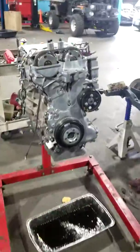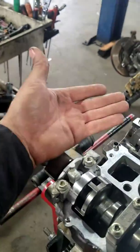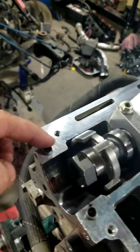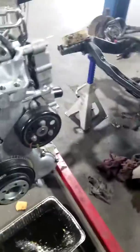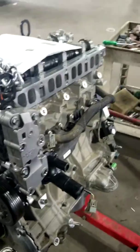Once you've got all that stuff locked in, plug in the back, cams in the back. One more thing to mention: the cam cap in the back — when you take it off to get that tool in, you've got to pull these little dowels out. If you're lucky, they come out on your cam cap. I was not lucky — a little vice grip, a screw, and some PB Blaster, and it popped out.